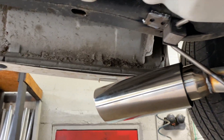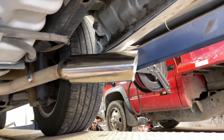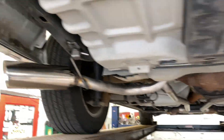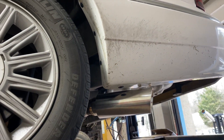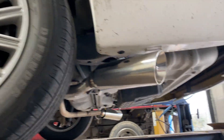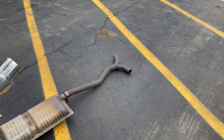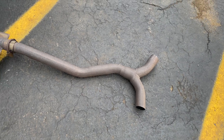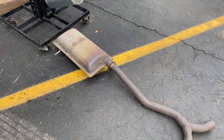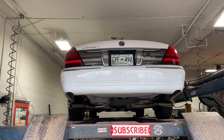You wanted the tips out the sides instead of out the back, which I like — it's a nicer look. Right there and right there with double-walled stainless steel tips, they come out really clean looking. There's the other side. It comes into a single where we true dual'd it — that white pipe right there. We cut it right before there, that's how you true dual these. There's the muffler.